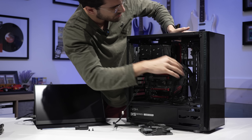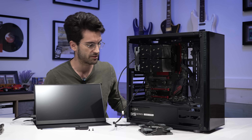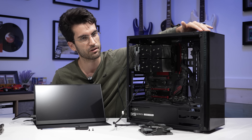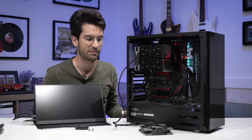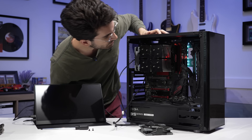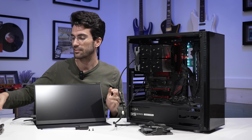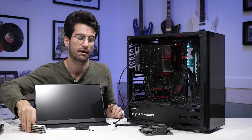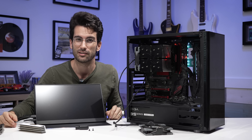Just to prove the point, I'll go ahead and insert my known working DIMM. I'm just trying to show you that you don't have to have a bunch of hardware on hand to effectively troubleshoot. This isn't totally foolproof, but it will definitely point you in the right direction — I'd say 9, 9.5 times out of 10. And as expected, the CPU debug light is still illuminated. So I didn't necessarily need a known working DIMM to rule out what I already had. It's kind of an archaic way of doing it, but it's cost effective.